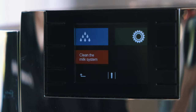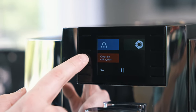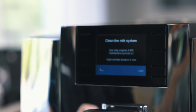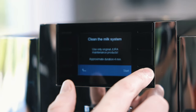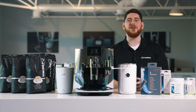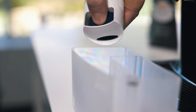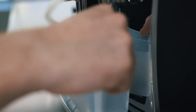So what I would do is select the gear, and you'll notice on the screen you'll have a red blurb that says clean the milk system. You select that, and the machine will then say start the milk system clean process. You click the start button and that initializes your sequence. It'll tell you to use Jura products. You're going to dispense one click into the first chamber, connect your milk tube, and select start.